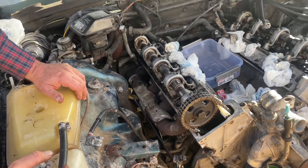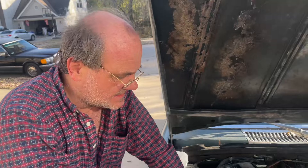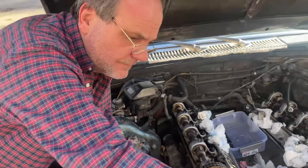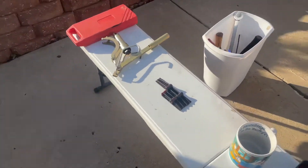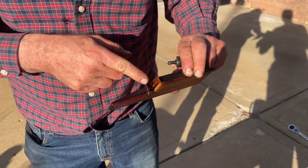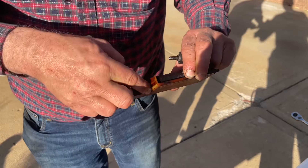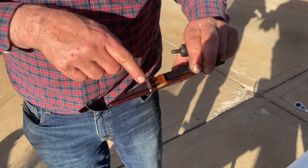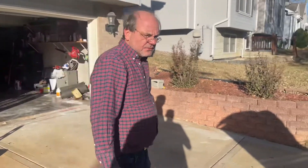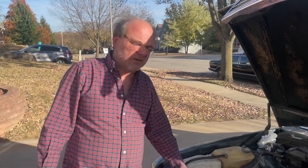The best thing would have been to do a complete engine flush when they parked it, but they left the oil in it. We also need to open up the oil pan because one part of the broken guide rail — it fell in three pieces — is laying in the oil pan. We have to take off the oil strainer to see if it got into the strainer or if we find it in the pan. That oil strainer rubber will have turned so hard it's like plastic — you need a hammer to break it off and then put a new one on.